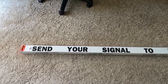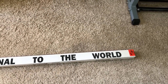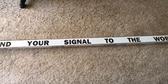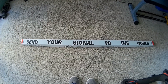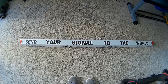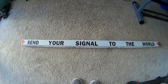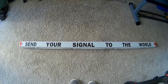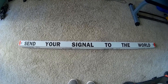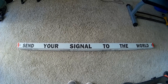Hello and welcome back. What I'm showing you right here will give you an idea what today's video is about — it's the Solarcon A99 antenna. Two reasons I chose this antenna: I've read really good reviews on it and hear it's a great antenna for the price. I also like that you don't have to put it up too high, and it works on 10, 11, and 12 meters without having to tune it. If you choose to use it on the ham bands it will work up to 20 meters with an antenna tuner. So I thought this would be a great all-in-one antenna.